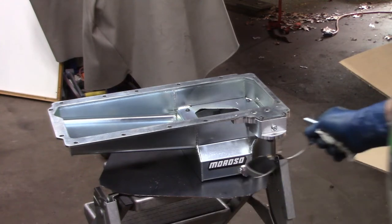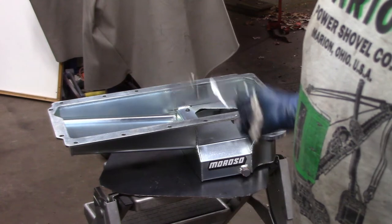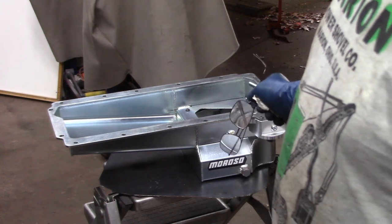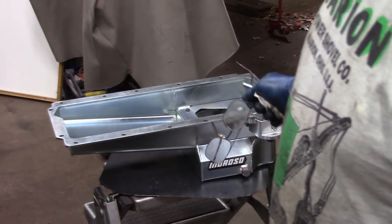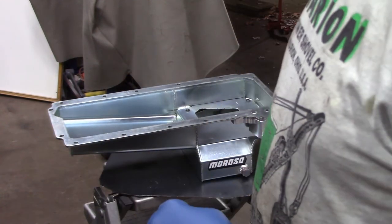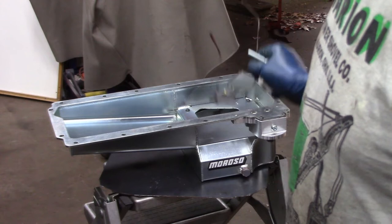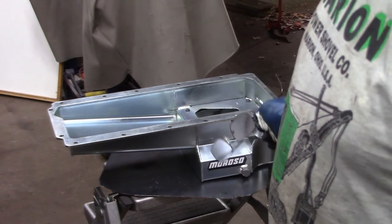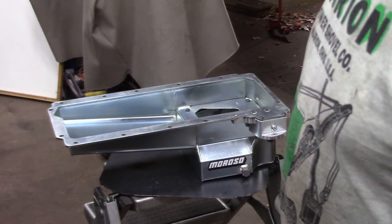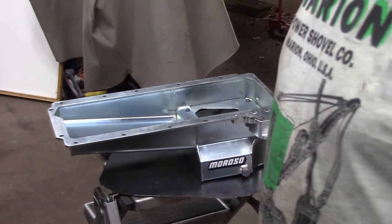So, all right, again, I'm super nervous about putting this up to the bottom of the engine. Then I can put my cross member in, put the rack and pinion in place. The other thing that I'm trying to do is educate everyone that's in the same boat that I am, trying to LS swap a Mazda pickup truck. Surprisingly, there's more than just a couple. I put the headers on to make sure that the exhaust header collectors would clear the pan, and the primary clearance problem would have been the steering geometry and the cross member. So let's see how we did on the preliminary calculations.